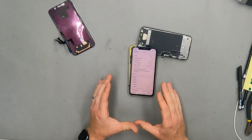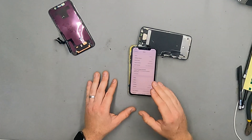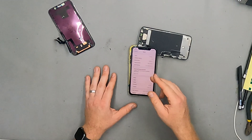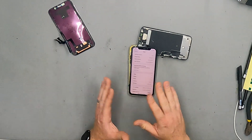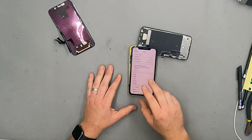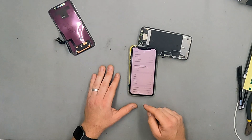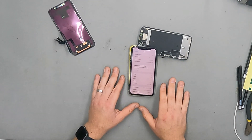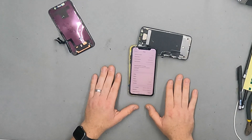This means that if you have done any repairs to the iPhone 11, iPhone 11 Pro, or iPhone 11 Pro Max using this aftermarket copy style of screen — where it didn't show a notification on iOS 14 — and you carried out a repair for a customer on iOS 14 without discussing this message with them, then when that customer updates to iOS 15 this message will reappear on the lock screen. They'll get another four days before it goes back into the settings. When I first updated this phone to iOS 15 and connected this display it did appear as a notification on the lock screen constantly. So if you've used this quality of screen for any repairs and haven't had that discussion with your customer, be prepared when iOS 15 drops to have customers asking questions about what it means — and have a good explanation ready. There you go, take care guys.